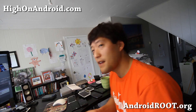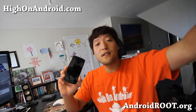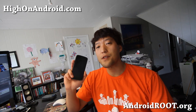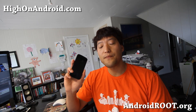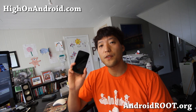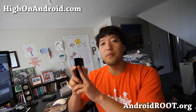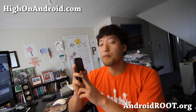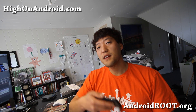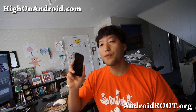Lastly, let's talk about Nexus devices — the Nexus 4, Nexus S, or Galaxy Nexus. Any Nexus device is very easy to unroot completely back to stock. You can use the original firmware that Google provides. For the Nexus 4, simply download the original firmware, run some fastboot commands, and it'll get completely back to stock. You can also relock the bootloader, which will erase everything on your phone and make it completely stock. When you send it back for warranty, Google or LG will not know that you've rooted your phone.